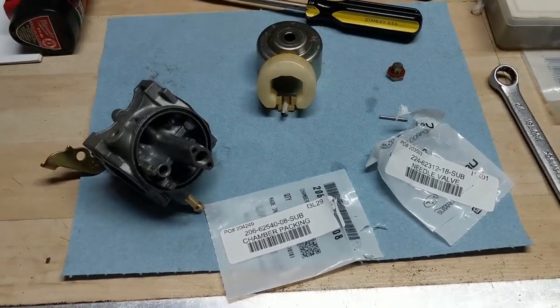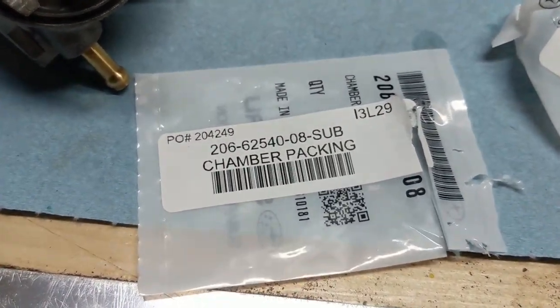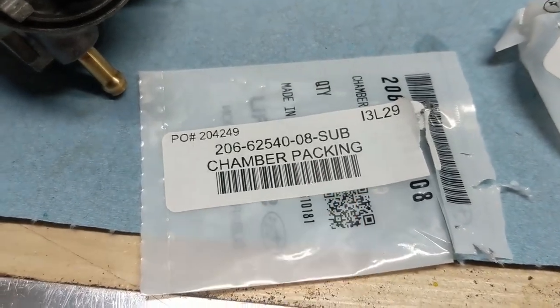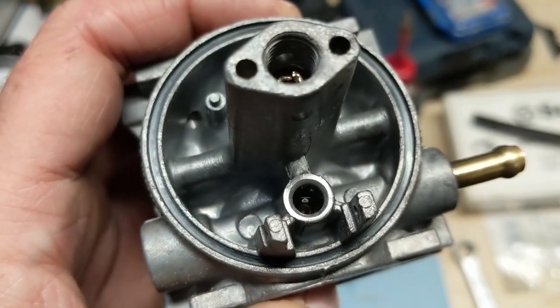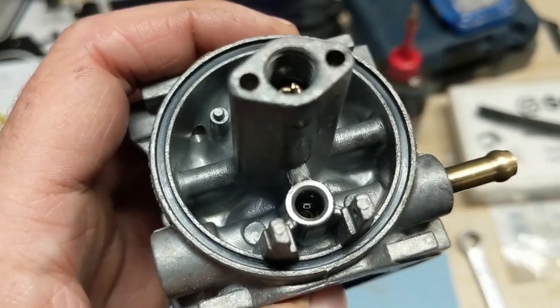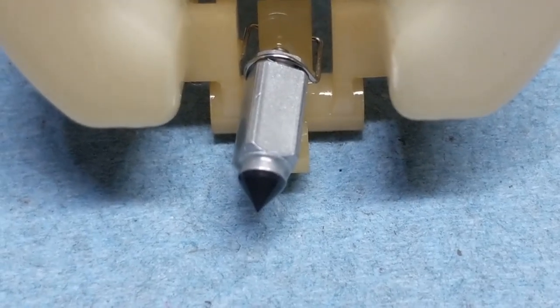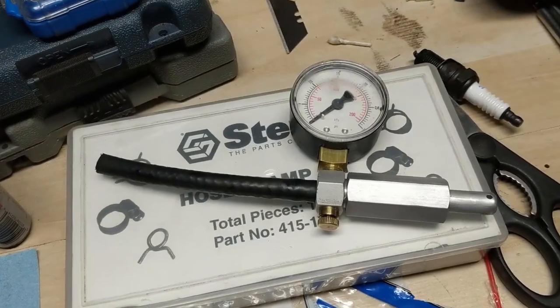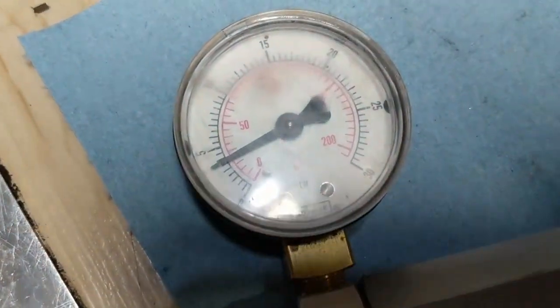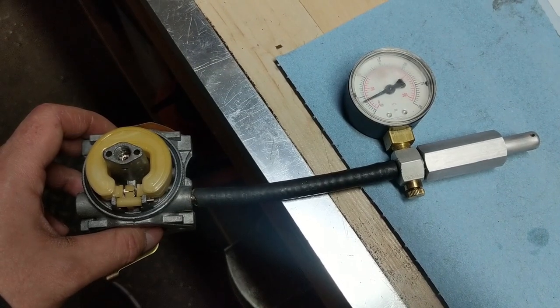It's been about a week and I finally got my parts from Montreal — a brand new needle valve and a brand new bowl gasket, which they call a "chamber packing." Both part numbers will be written in the description. I've laid in the new bowl gasket since the old one had a little crack in it. I put a little bit of three-in-one oil into the fuel inlet, installed the new needle valve and float with the float pin, then hooked up my carburetor pressure tester. With the carburetor upside down, it's holding at about three and a half PSI — so this is not leaking and the carburetor is ready to go back on the machine.